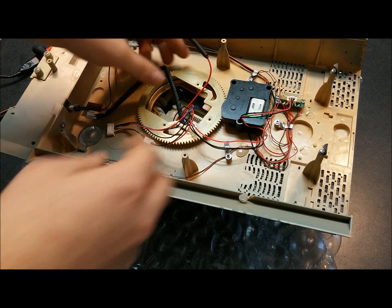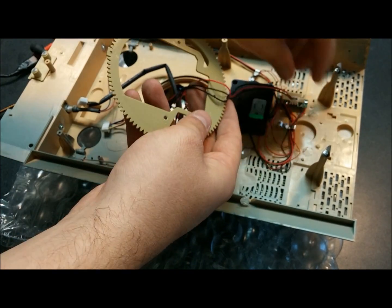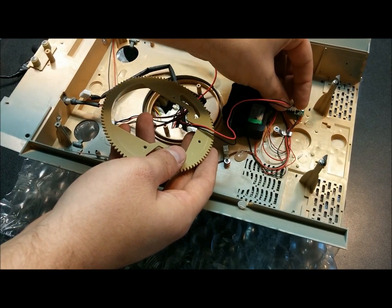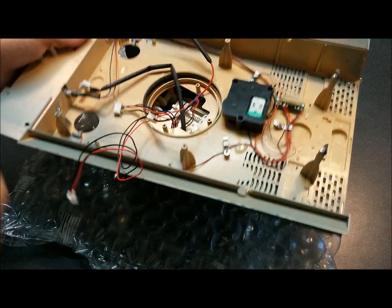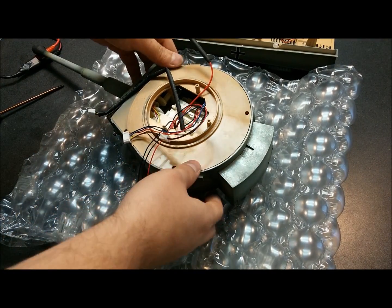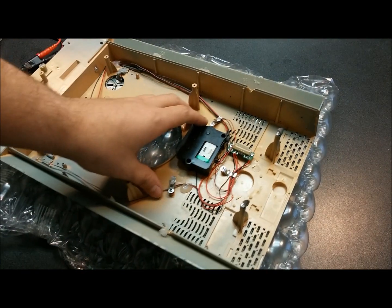Okay, now we are clear to remove the turret ring. You also have to remove this little three-pin connector — remember to note the orientation it's in, or take a picture so you know which way it was before you took it out. Now the upper hull is free from the turret, which is what we wanted. Go ahead and set the turret aside.